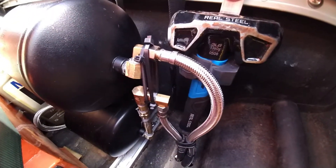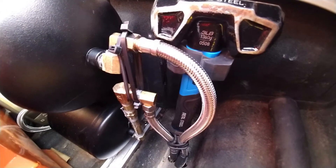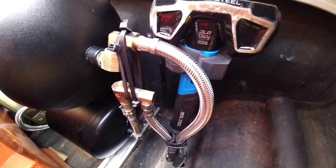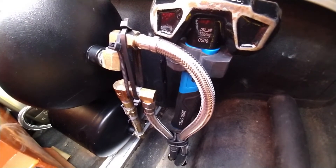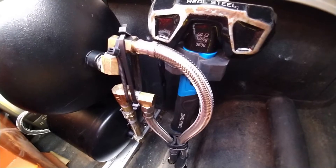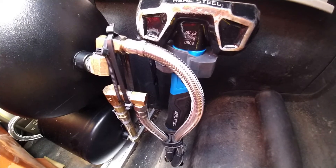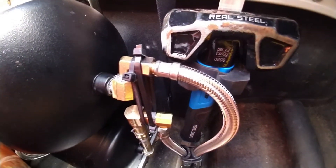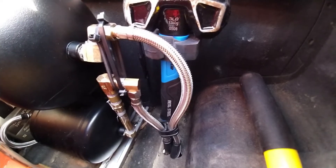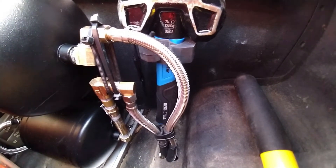I went ahead and replaced some of the lines here with stainless braided. You're probably going to get a great chuckle out of where these came from and what they cost — these are only about seven dollars a piece. Most people think that stainless braided lines are very expensive, and depending on the application, yes they sure can be, especially if they have to resist very high pressures or corrosive materials. But these are actually water faucet lines from the plumbing department at Lowe's. These are three-eighths compression, and I put in three-eighths compression by one-quarter inch pipe thread adapters. I went ahead and put those in, removed some of the red plastic tubing, and made the junctions underneath the truck instead, because I thought this would look better and would also probably be a little stronger.